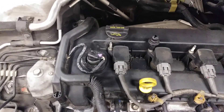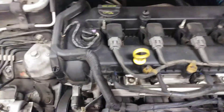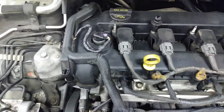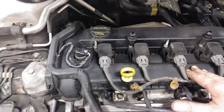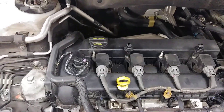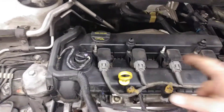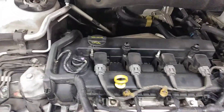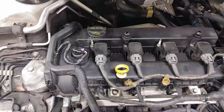That's pretty much what you have to do to run one of these engines. If you run a 2013 and newer Ford Fusion, you have a smaller solenoid which isn't interchangeable. So you either have to run the Fusion valve cover that already has the grommet in it, or do a little bit of modification — as I described in the last video — to get the grommet from the Fusion valve cover into the Mazda 6 2.3 valve cover.